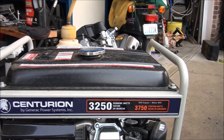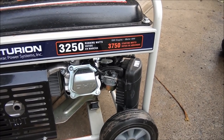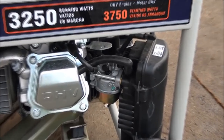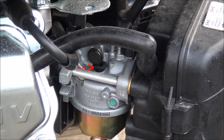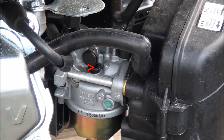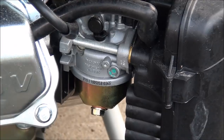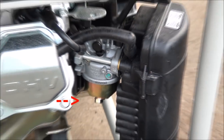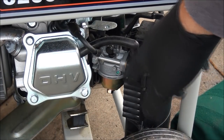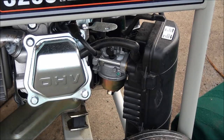I think I like that angle a little bit better for you all. This type of carburetor is pretty easy to work on. That black plug there going down into the carburetor is where your slow speed pilot jet is located, and the main jet you have to take off the float bowl to get to. The reason I mentioned the slow jet and the main jet is because that's the area of the carburetor that usually gets plugged up.